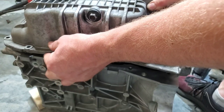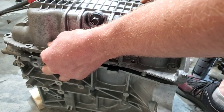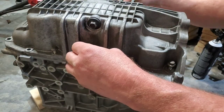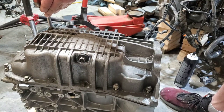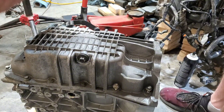Let's take a bolt or two in there to kind of align the pan, and that way you're not smeared all over the place. And drop the pan on there, drop the rest of your little bolts in and then run them around and then torque them to factory spec. I would not call this a mission critical bolt. So German tight's good enough, Guten tight.